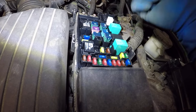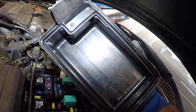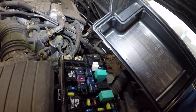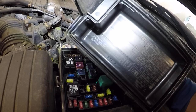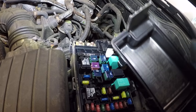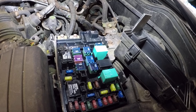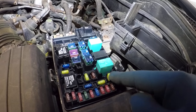You can take this fuse puller tool inside and use it to pull the fuses from the interior fuse box. There might also be spare fuses in this box. Let me check — it looks like there's a 20 amp and a 30 amp spare here, but no 15 amp spare. You can buy replacement fuses from a regular store.